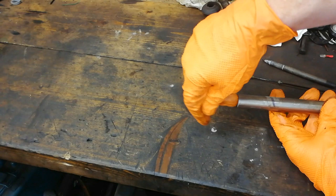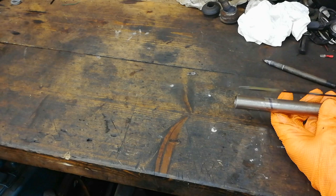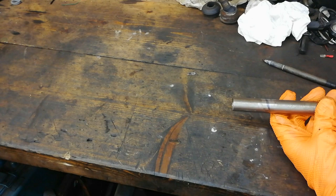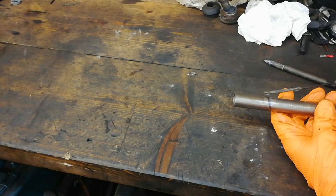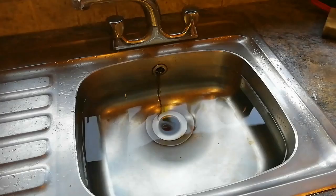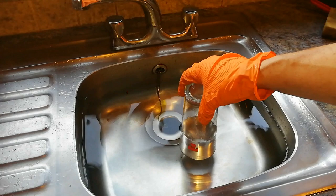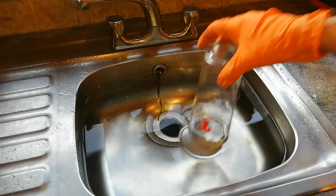What's going on there is a bit like this: here's a sink full of water and we've got a pint glass. We dunk it down and the water doesn't go into the glass — that's air trapped inside because the end is sealed. If we release the end, the water will go up into the glass. Same principle with the dipstick tube — once you open the end, the oil can travel up and you get a proper reading.